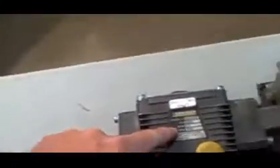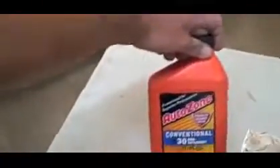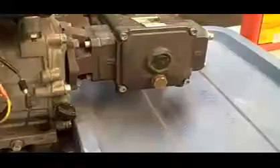On this particular water pump, the Karcher 2500 series water pump is which one we use. You want to make sure you use this non-detergent so that it doesn't foam up in there, because you put water and foam together, then you have a big problem. It's a very important step when you're servicing this. So I'll set you over here on the tripod and I'll show you how we get started here.